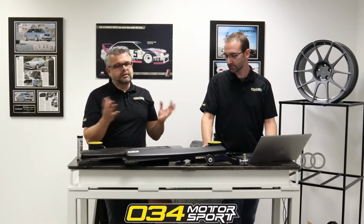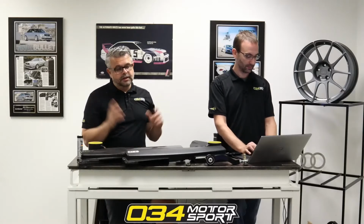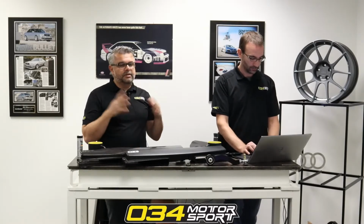Here's the thing with upgraded clutch packs. One very notable tuner, when DSG first came out, didn't have good DSG tuning. In other words, the TCU didn't apply the right line pressure to the clutch packs to increase the clamping force, and so the stock clutches would slip, and they blamed the stock clutches, saying that the stock wet clutches, which are amazing, were too weak and didn't hold. So they went to some company, and an aftermarket variant was released with a clutch disc material with a higher coefficient of friction, which just means that because they couldn't squeeze the disc harder, they made the discs grippier. And so they did hold slightly more power.